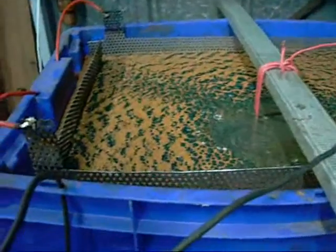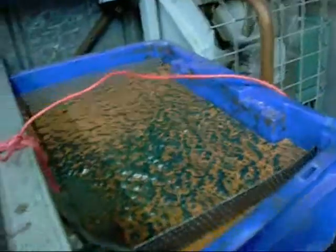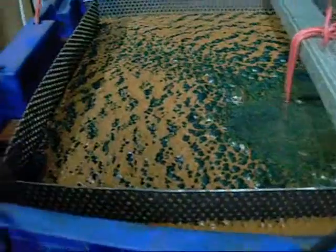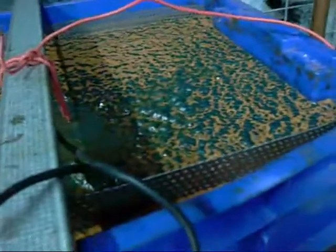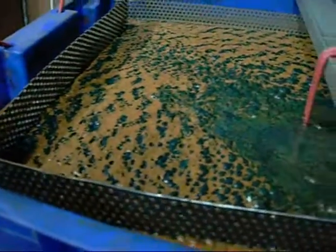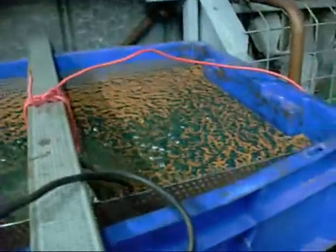Well, it's been a few hours now - maybe two at the most - there should be plenty for this job. Fresh anodes and fresh solution, it should work very quickly. There's a good film built up on the surface of the tank and a lot of hydrogen bubbles. This is where you have to watch the sparks from grinding, because each one of those bubbles can detonate quite violently and the whole surface will just blow up, covering this whole area in brown sludge.